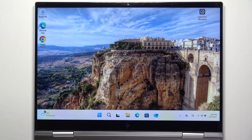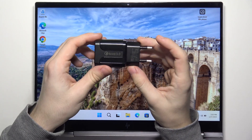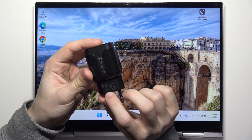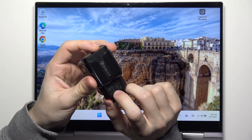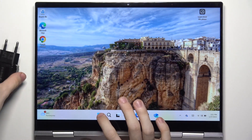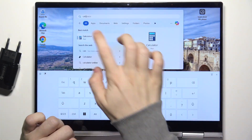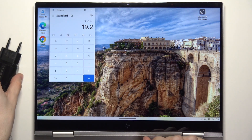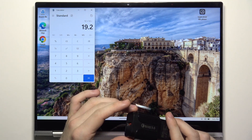Although if you don't have it with you, you can use another charger. Here I have a charging brick that's pretty small. It says that it supports Quick Charge 3.0, but it says 12 volts and 1.6 amperes. When we calculate it — 12 volts times 1.6 amperes — it's 19.2 watts, which is much less than the 65 watts.